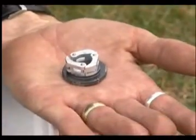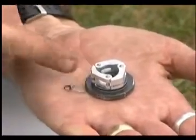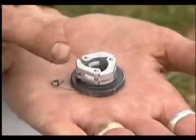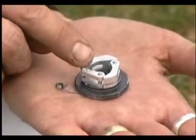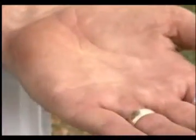So to hold them back, you fit springs like that, and it holds it down, and the tension of that spring determines when that flies out and bites the clutch. Likewise, the weight of those clutch shoes determines how much centrifugal force they've got to overcome the spring and make a bite. But there's various types of clutches.